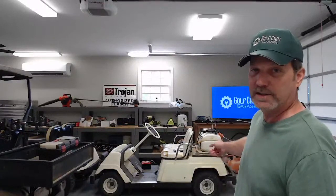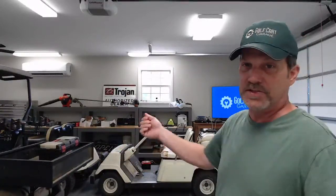A lot of times in some cars, not all of them, because I've got that G1 right there, I've got the governor tight on it, and it still can go slow. But some other cars, some newer model cars, I've found that when you try to adjust the governor to make the car go faster, if you go too far, it will affect the slow speed driving. So that sounds like what you got going on to me.